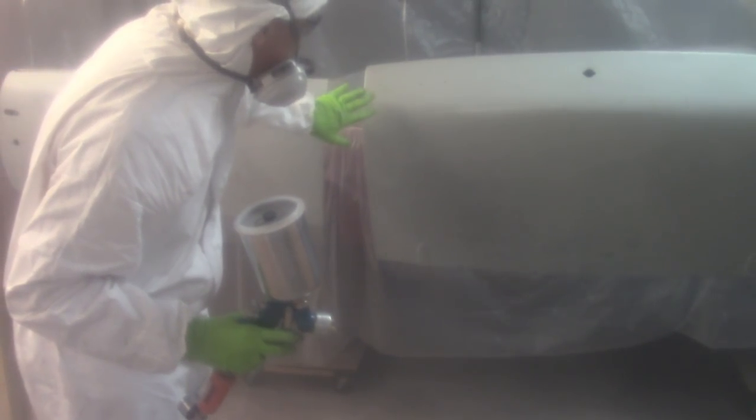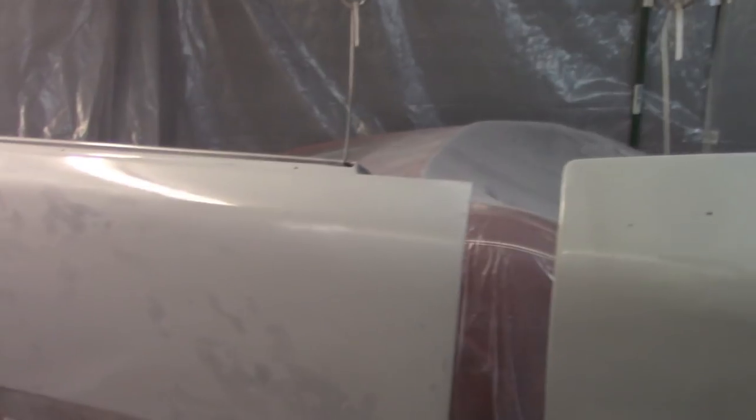I went a little real heavy over here — that's pretty bad actually, didn't follow my own advice. There's going to be a lot of sanding involved there. Back in the booth — it's only been about two minutes, about 6:25 or so — I'm going to let this sit for about 30 minutes between coats. The door came out pretty good — still kind of mottled, which was to get a lighter first coat. But hopefully you can see right there the nastiness where I painted too heavy. I don't see a repeat of that cratering though.